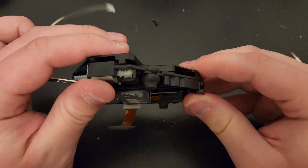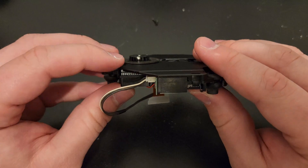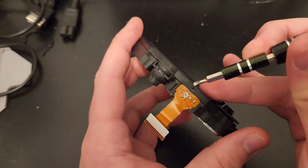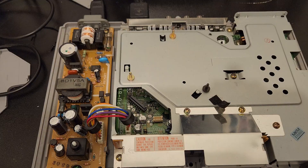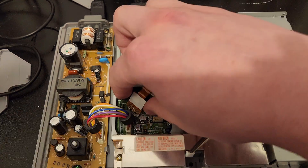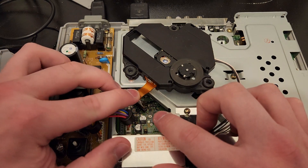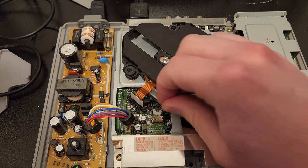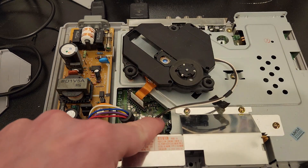Now just let the clips go into place. Before you put the screws back in, make sure that you have slotted the ribbon cable into this little groove right here. Installing the drive is really simple — just place it on top of the pegs here. For the ribbon cable, make sure you push it down all the way and then press down on the tabs on each side. For the wire, just press it down, make sure it's lined up, and then use your fingernail to push it down all the way.